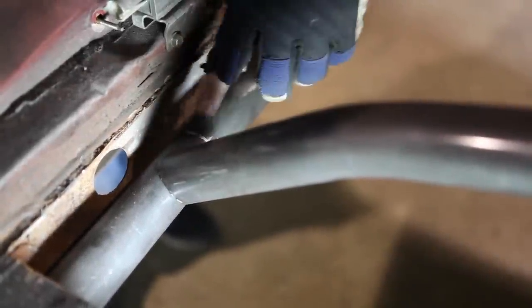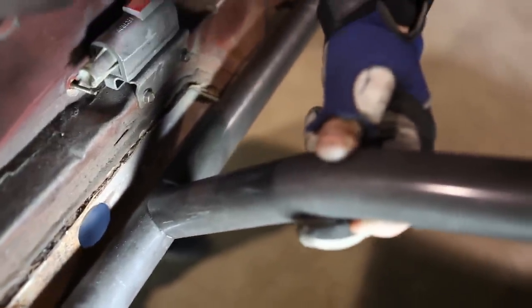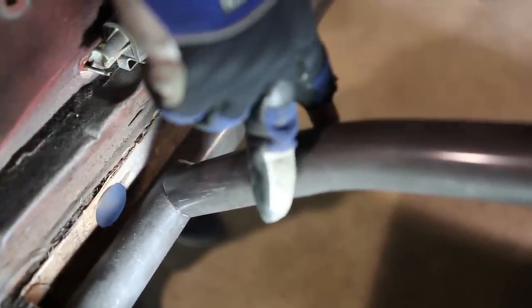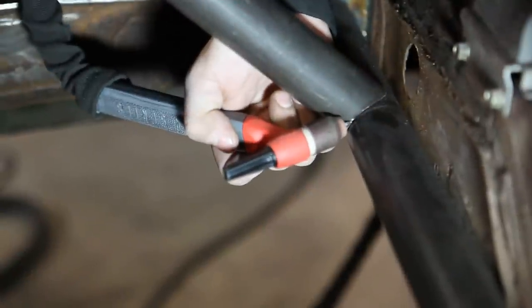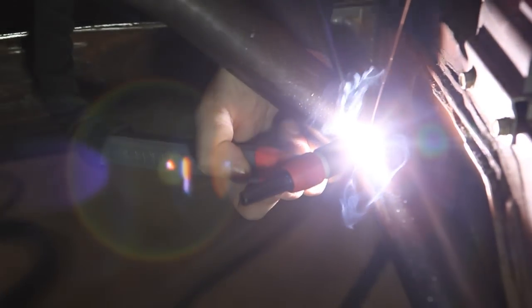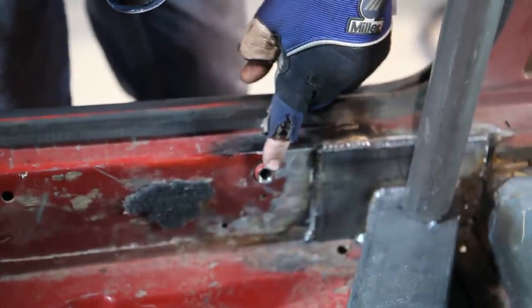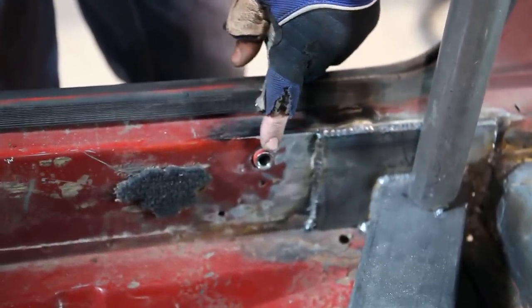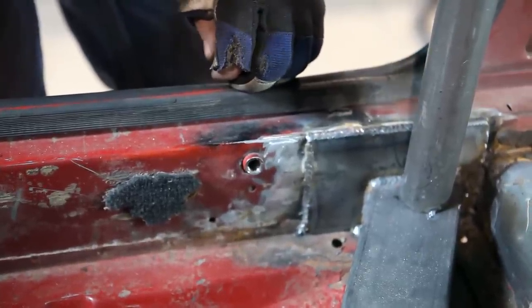I've got a line marked with a silver Sharpie — you want the inside edge of this bar right on that line so that you're at exactly 26 inches. When you're 26 inches back here, everything will be squared through the front half of the cage, so when you put your triangulation bars in, they slide right in and everything sets right into place. Here we have the factory seatbelt tab — this might come into interference with your rocker bar, so you might just have to grind down the edge a little bit so that it slides down into place.